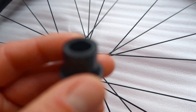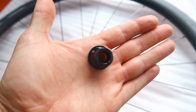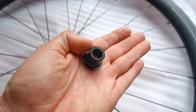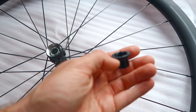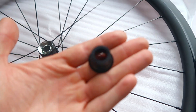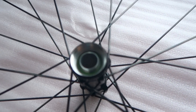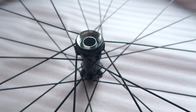I've said this in other wheel videos - I'm not a massive fan of knurled end caps. If you've got carbon dropouts on your frame and you're putting the wheels in and out of the bike quite a lot, they do tend to bite the soft carbon dropouts and over time damage them. I don't think it's necessary if you've got proper axle bolt clamping load - 12 Newton meters or something like that. A simple matte or sandblasted finish that's anodized is good enough to provide grip. If you're testing wheels like I am, or in and out of the car traveling with the bike, they're a little bit annoying.